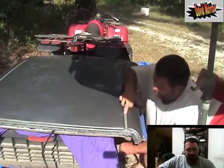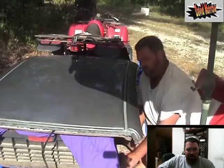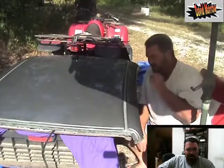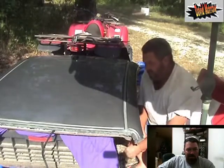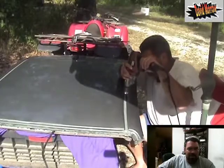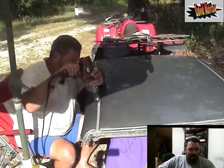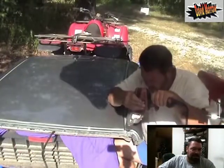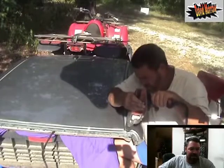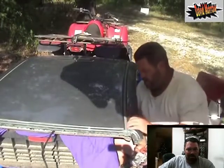Get as close to the center of that divot as you can. You'll notice they didn't put a spot weld from here all the way down to there — it looks like they skipped a few. They do that because they probably can't get the welder arms back there to spot weld in certain spots because of the side panels of the car. Not a big deal — you'll see some of them have a gap. Okay, got them all done on this side.